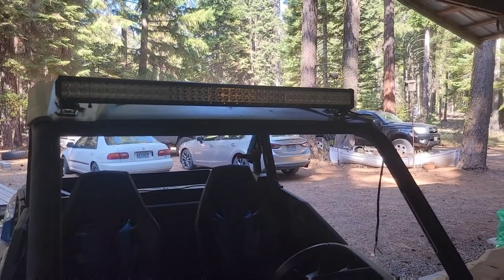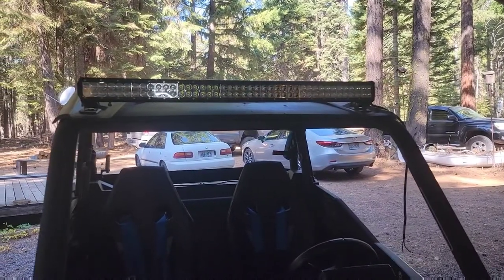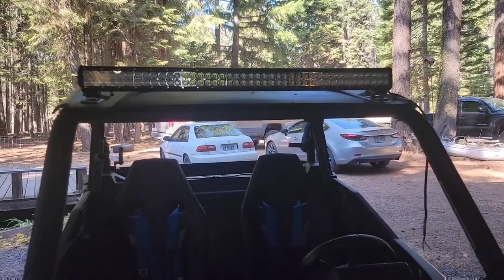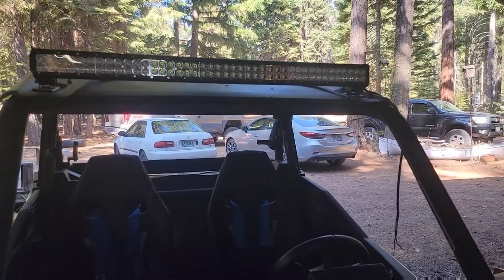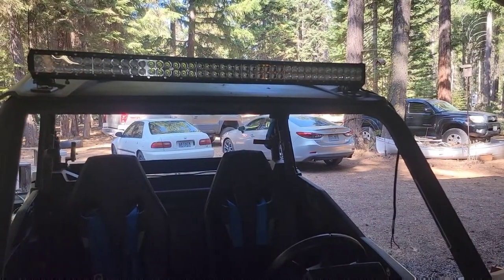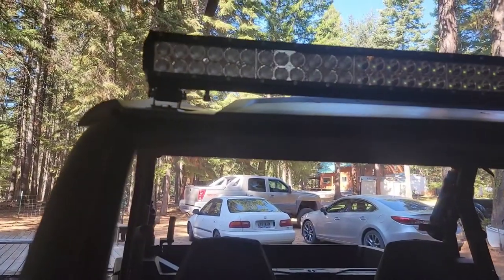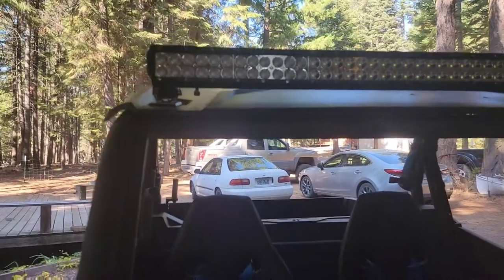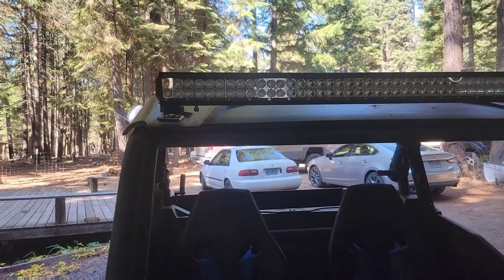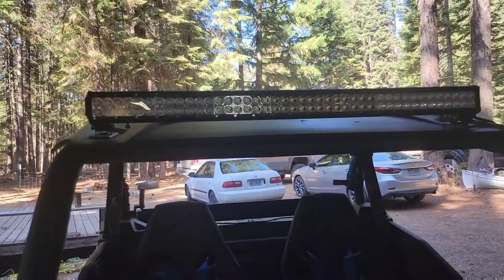On the top light bar we also went with a sliding bracket mount style. There are four brackets overall on these larger light bars. We removed the two middle ones because of the hump in the middle of the roof. In order to keep the nut inside from rattling around, we moved the mounting bolt to the side. We have the mounting sucked up tight to the roof right now, and the adjustment bolts are still loose — we'll tighten those down later.